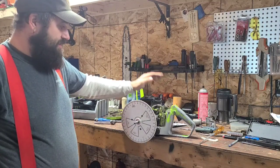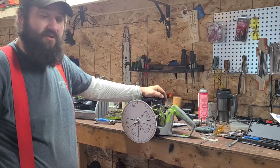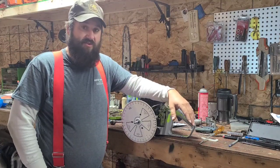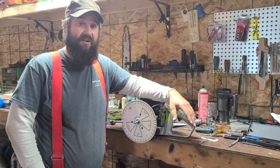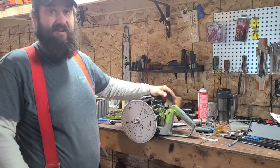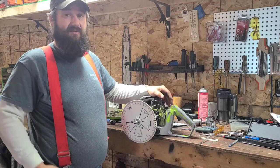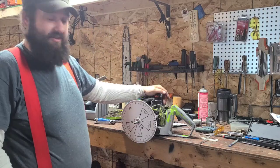So there you guys go. Pulling 5200 counter vibe. I have my timing numbers. 104 on the exhaust after top dead center. 117 on the transfers. So what do I do now? Do I just go grinding away? No. I'm going to think about this one for a few days. Ponder it. I'm going to go through my notebook and see if I have any other saws that have similar timing numbers and see. Did I manipulate those saws? Yes. How did they run? What are my overall timing numbers? And go from there. That's the name of the game in my world.